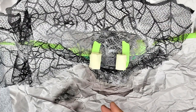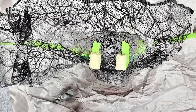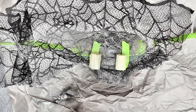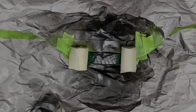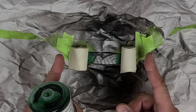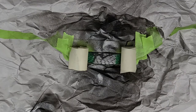So I can go with the silver and the lace now. I found my piece of lace that I need to put in this area — I've stretched it out a little bit, same thing with the rolled pieces of tape. Now I want to dust that with the silver. Let it sit for a bit, come back and take a look. I might have to hit it with a little bit more silver, but if not, a little bit of wet sanding and I can hit it with the green. That's about three very light coats of silver, and as you can see my work area is getting wider — there's a reason for that because I have to blend this in after I put the clear on.